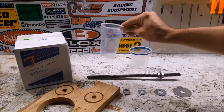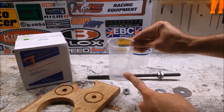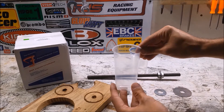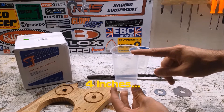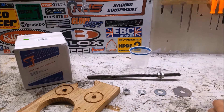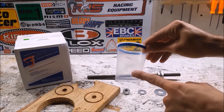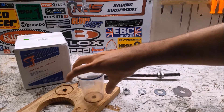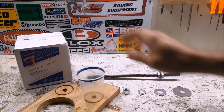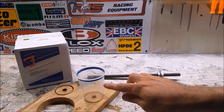The way this is going to work is I took this cup, measured up from the bottom until it was about two inches in diameter, drew a line, then measured three inches up because they need to be three inches tall, and made another mark — which left us with this cup. So here's the two-inch diameter and here's the top, so we have our three inches of depth. Using a two-inch hole saw I made a small indention in this board, and this is where our urethane is going to be poured.